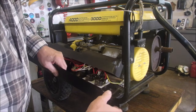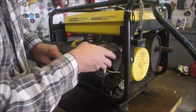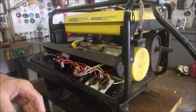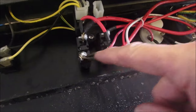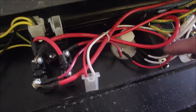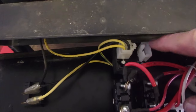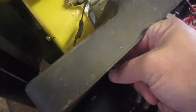One note of caution. You see this yellow wire sticking right here? It actually comes through the back on this little notch here and it grounds out right there, and that's the ground for the whole panel. Okay, so right here is a little relay. It senses, this is the red lead. It comes from the breaker to the meter and then over onto this clip, which was clipped into here, right there. Do you see that? I just disconnected that because this relay was firing a little too early, causing a ground to be put on to our coil that shuts the engine off.